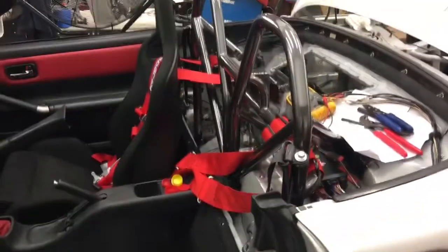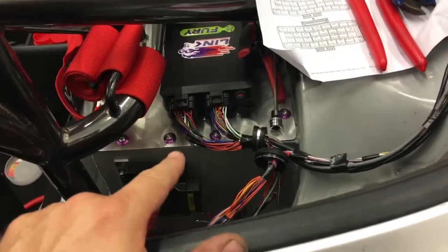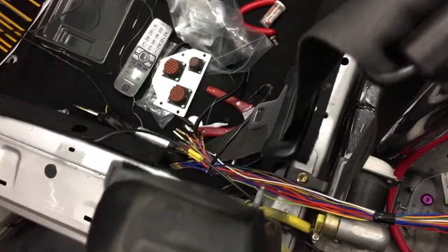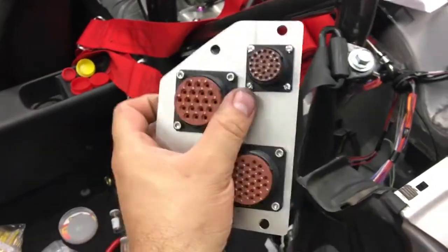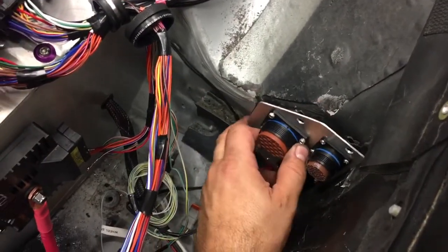Coming over here, we have a couple of cool things going on. We've got our roll hoops back in the car. You have our Recaro seat with the Sparco four-point harnesses, which looks awesome — they'll have matching seats obviously, this one's out while we're working on the wiring. And then you have our Link G4 Fury, which is the engine management system we're going to be using — that's what I've been working on the harness for tonight. I've got all the harnessing to it done, all the pins already crimped on the end. I just need to put them in the mil-spec connectors. I've got a few more wires to add for the body harness, and then this is how the mil-spec connectors are going to be set up for the engine-to-body connection, mounted right there.